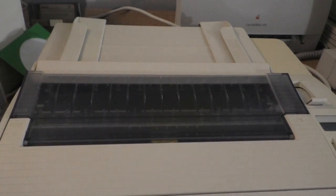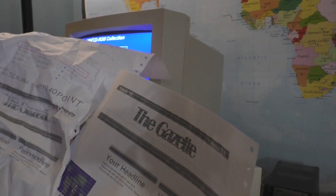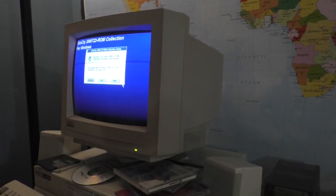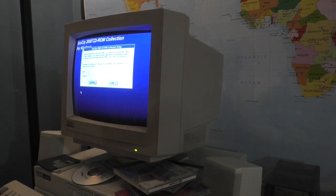So, what I did notice, if I can find the previous printout. By changing it to quiet mode, normal mode, it darkened it a little bit, but I also set the printout to be slightly darker on the control panel, so I'm not sure which. I should have done them independently, but there's a lot of banding here. Now, banding on a color dot matrix is pretty much a matter of normalcy, but with an aged out ribbon like this, it's even worse.